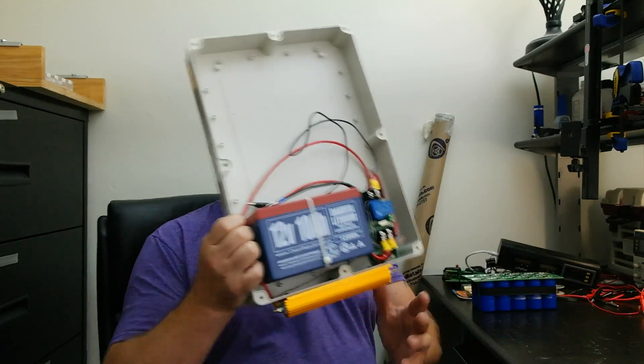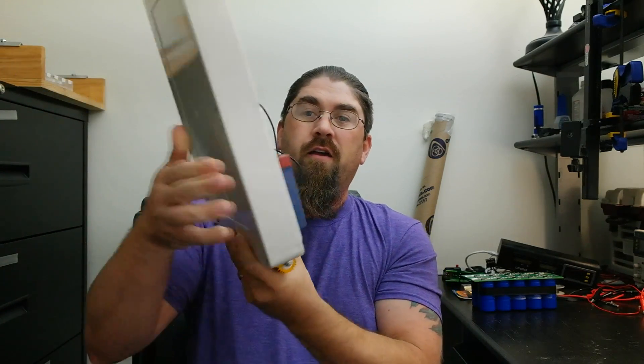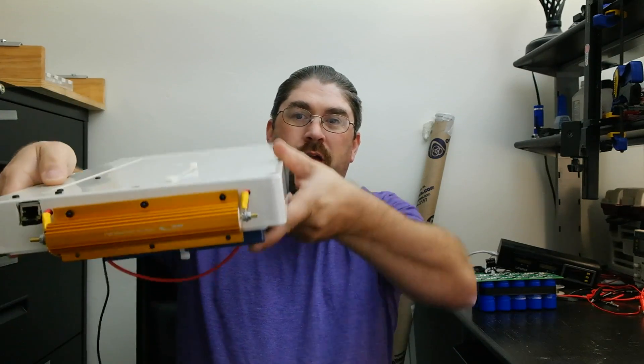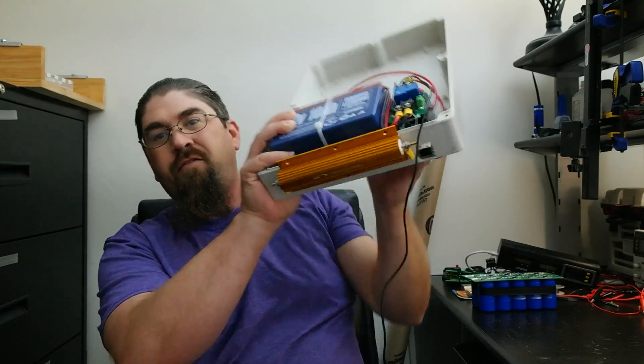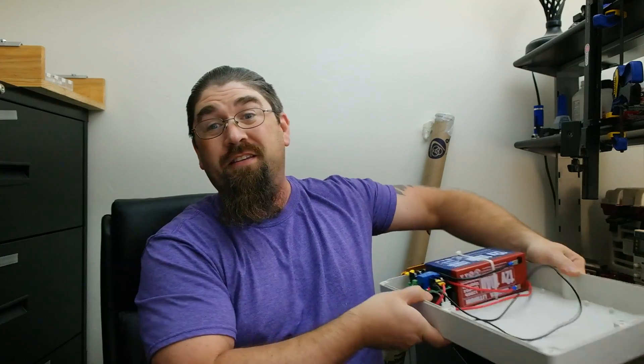The battery is only meant to handle the parasitic loads in the car. I had it mounted in the case — it's not going anywhere. It's a zip tie running through the back and then zip tied to itself again. It doesn't have to be a fancy mounting as long as it's safe. You don't want anything with electrical potential moving around if you flip the car or slam on the brakes. The case will be secured in the car, and we have extra space for the supercapacitors.